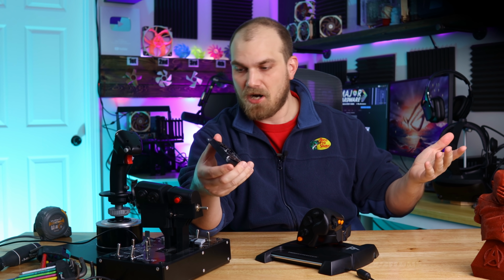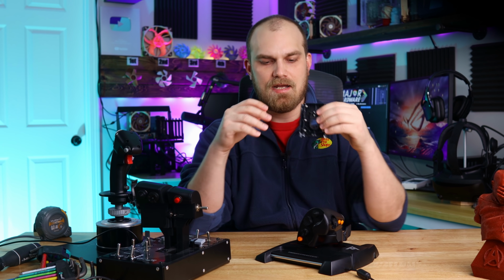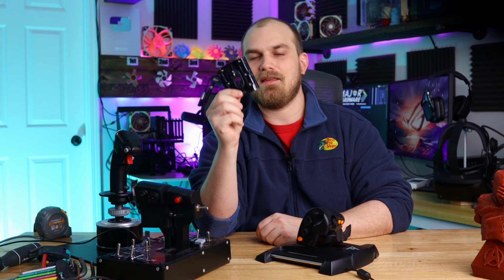So what we need to do is get a new bearing plate, and instead of just using plastic on metal rods, we're going to use linear bearings. The bearings you can get for this are actually really cheap, about 10 bucks on Amazon. I'll leave a link in the description below. You don't have to change the rods. They fit right on the stock rods that come in it. But to use them, we need a new plate. And this is where it gets a bit tricky.